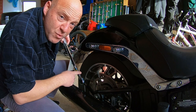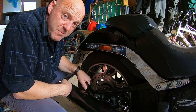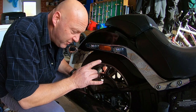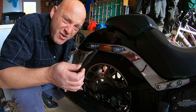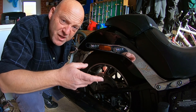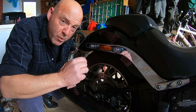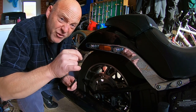If you haven't got a torque wrench, you could use your torque adapter with a pry bar or some piping and just lever it off and back on. But how do you know what the torque setting is? This is where a bit of pre-planning comes in. You can get a black marker, indelible ink, or marker paint — you may have seen this on bolts on your bike or in engineering applications as markers for nut or bolt creep. Torqued to specification, you put a mark on the bolt across the thread and on the frame, so you know they should always be aligned. If they aren't, you know it's moved.